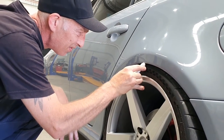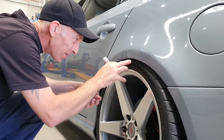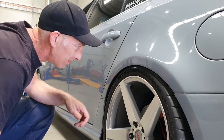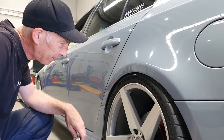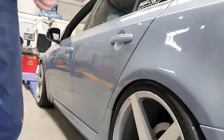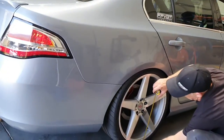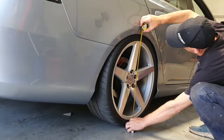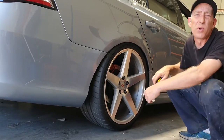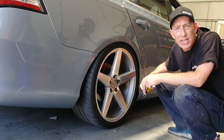The white mark thing's not really going to work, so we'll use a black marker instead. Let's get a measurement off the other side as well — it's 645, 646. Let's see how well Kev adjusted it last time. Spot on — 644. So we're pretty much spot on at about 644 to 645mm. We're going for about 5 to 10mm of raise. Alright, 645 — let's raise this up!